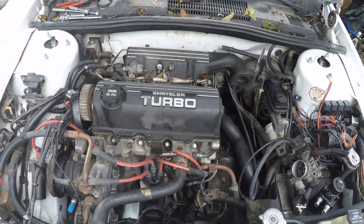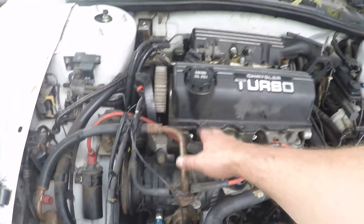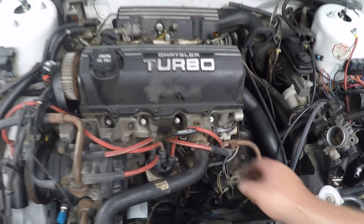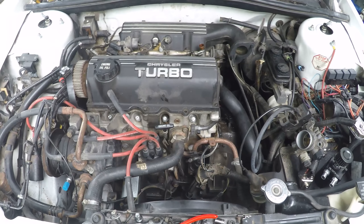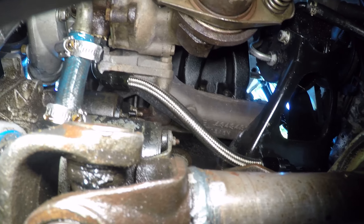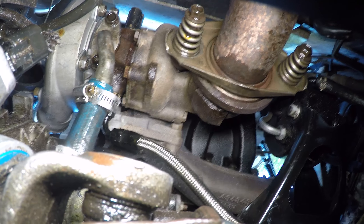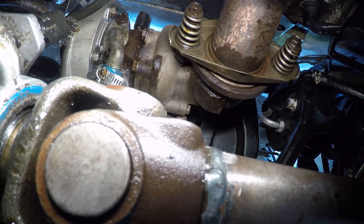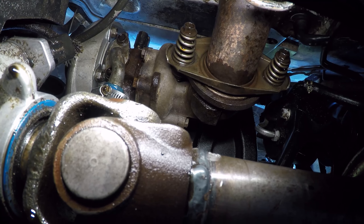There's the coolant sensor — coolant temp for the gauge. Outside of that, there's just not a ton of stuff to get this head off. Everything on the bottom side of this bracket is actually in the block, so no worries there. Since I haven't drained the coolant yet, I'm going to start the drain with the coolant feed — obviously the radiator hose is going to have to come off. There are a couple things up here I need to remove: the coolant line going to the turbo on the left, the oil return to the turbo, and lastly the wastegate valve bolts. Hopefully we can get this all squared away with the least amount of trouble possible.